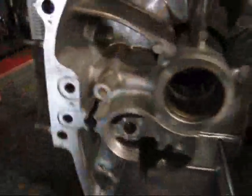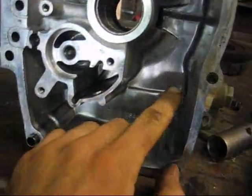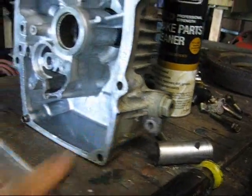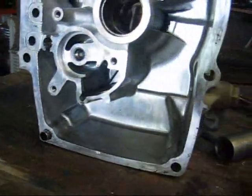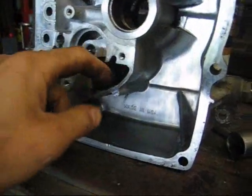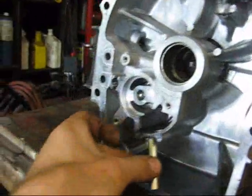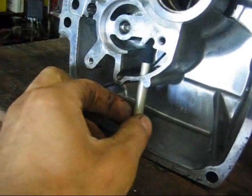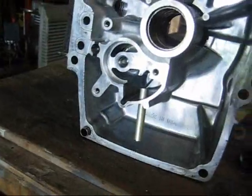So if I turn it this way, that's not going to work anymore because the oil level is going to be somewhere down here. I'm going to make it where this drain hole is, so it's going to be about this line — it wouldn't suck up there anymore. So I drilled the hole, I'm going to plug up that other hole, and I drilled the new hole down here. I'm going to JB weld in this tube to make sure it sucks up good.